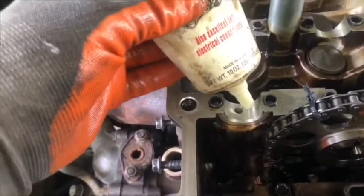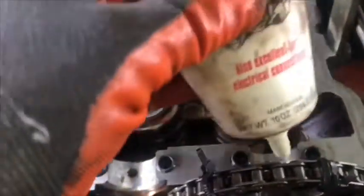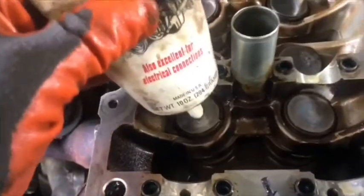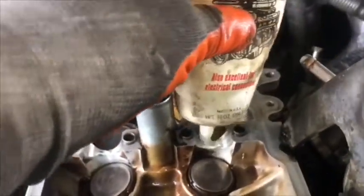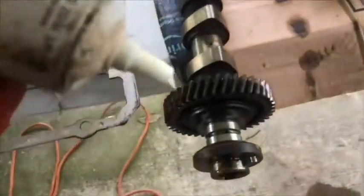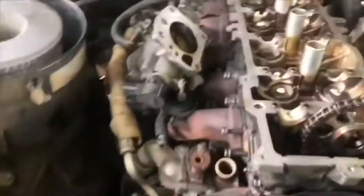Before putting the two camshafts on the head, we start by greasing the contact surface. This is so that when the car starts, the camshaft can work normally before the oil arrives at the cam. When you crank it, it takes a couple of minutes for the oil to go from the oil pan to the head. So it is very important that the camshaft works lubricated for 30 seconds or a minute. When you put the camshaft back, put some grease on the head, and I put some grease on the cam too, on the surface, in the holes for the rockers, where they keep turning.